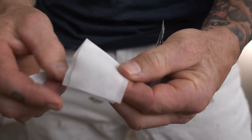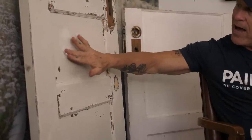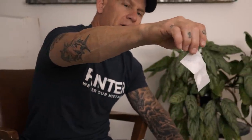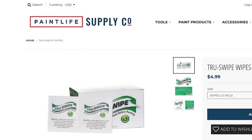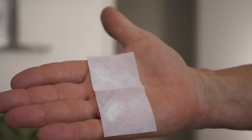The wipe has denatured alcohol and other chemicals including aloe vera, so it doesn't dry out your hands. You just swirl it on the surface — if it's latex paint, you're going to have paint on the wipe very quickly. If it was oil-based paint, the wipe will just clean the surface and there won't be any paint on it at all. That's how you know what you're dealing with.